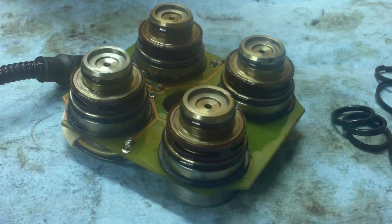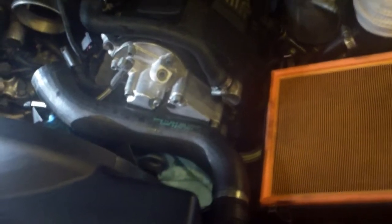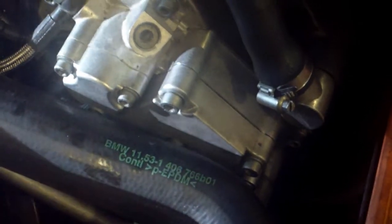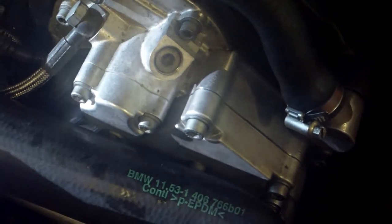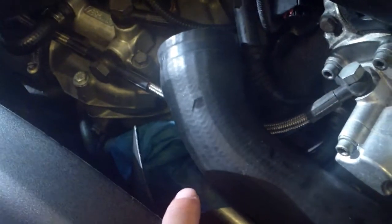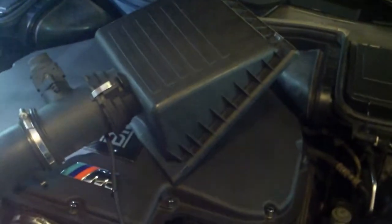Follow me outside and we're going to get this installed. As you can see it's installed — the new o-rings will be a very tight fit. What I did was put the gasket on the cover, put it on, and progressively tighten each screw little by little until it completely seated, then took it off, verified it was all in properly, and re-bolted it. Torque every cover bolt — all five of them — to 19 Newton meters or 14 pound-feet.